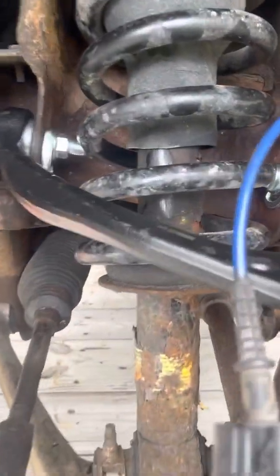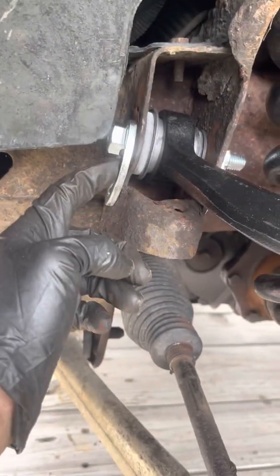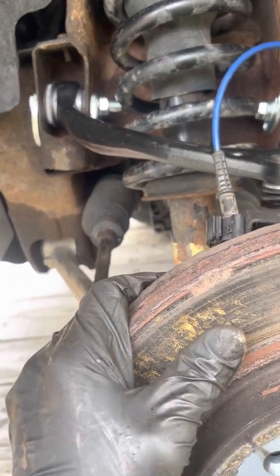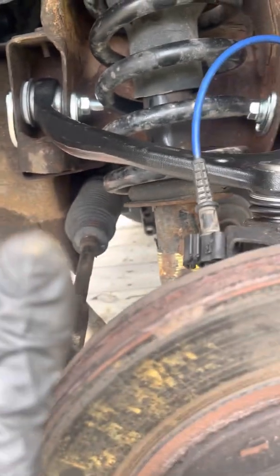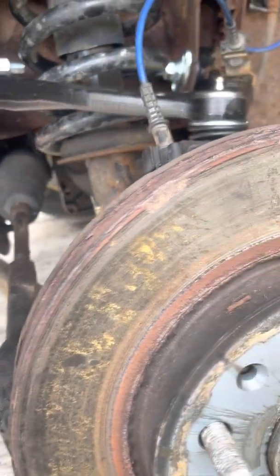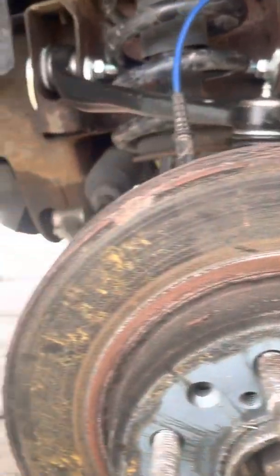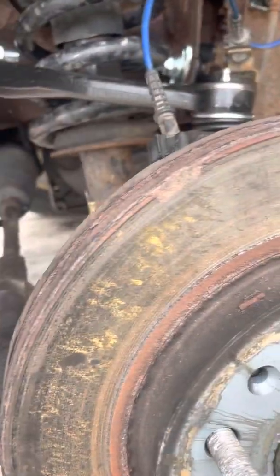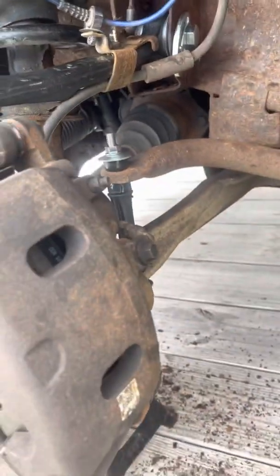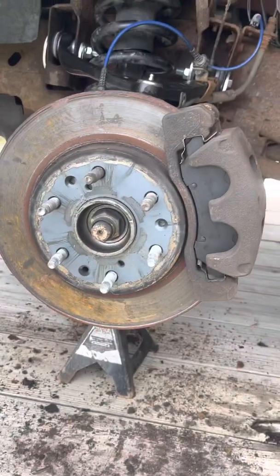And then if it is or anything, I'll adjust these top slides here, these cams, till this thing goes for an alignment. It's not going to be accurate, but it'll be close, so that it's not eating the tires. I mean, it should be going in a week or so, but it won't be perfect, but it'll be better than running around with the tire kicked out at the top or in at the top and eating the tire up. But it's together. Like I said, just gotta throw grease in it and I'll throw a tire on it.